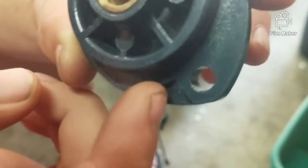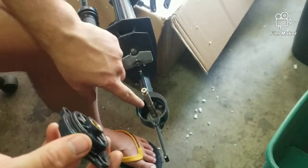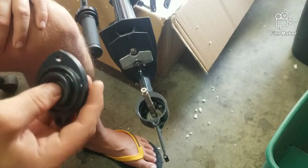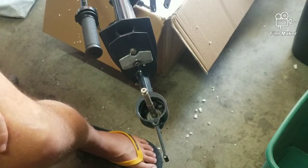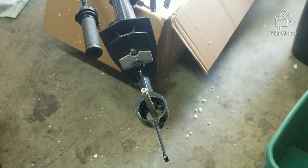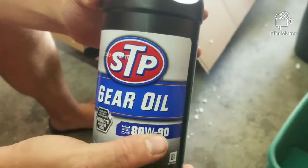You can get in there on this lip without worrying about it. I thought maybe the gasket would press around the outside, but it's actually one for the inside of this little area. There's one on the inside too, so you want to be very careful around this gear. When you scrape things they can get damaged. I went with 80W-90 gear oil because that's what I read online — it seems sufficient.